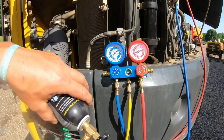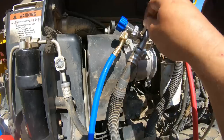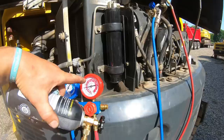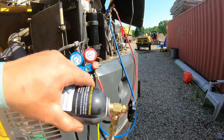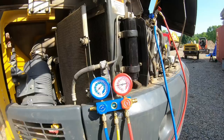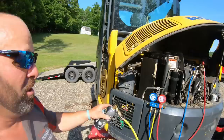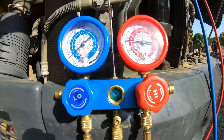We're going to do this three or four times to get all the refrigerant in, then check the readings and see if everything's working. Feel this line — it should be starting to cool off. This one stays warm before getting super hot, and that's how you knew there was a blockage — these would fluctuate, get cold again. Each time you change a can you need to purge the air out for just a quick second, otherwise you're putting air into the system, which is not good. Then take final readings after all four cans.